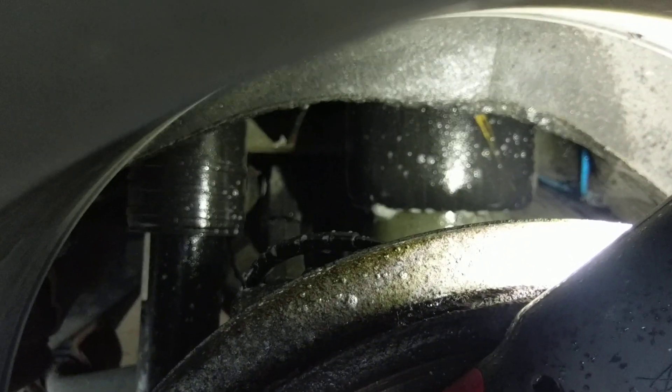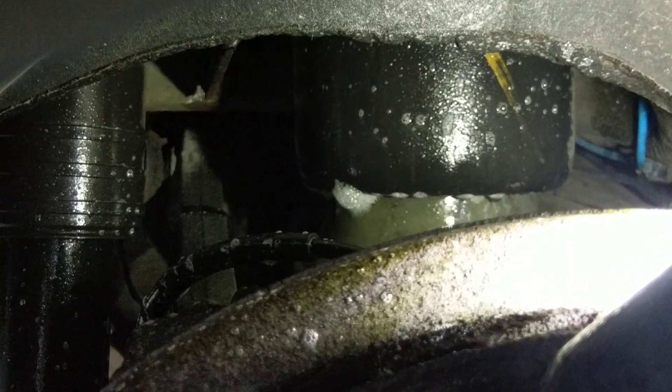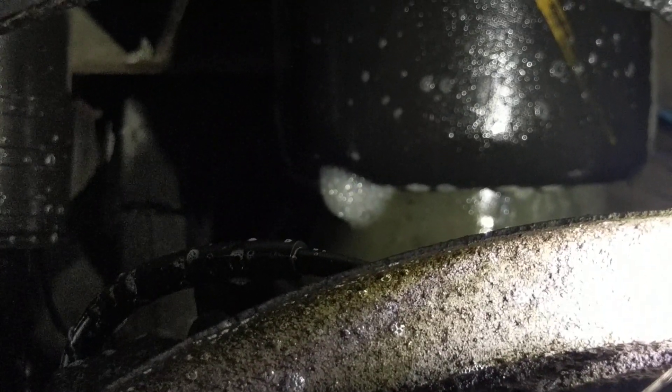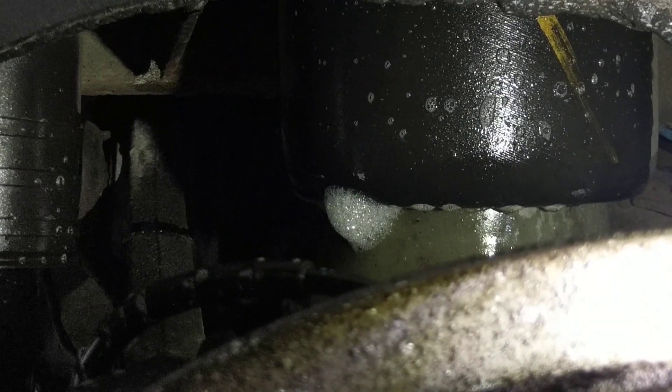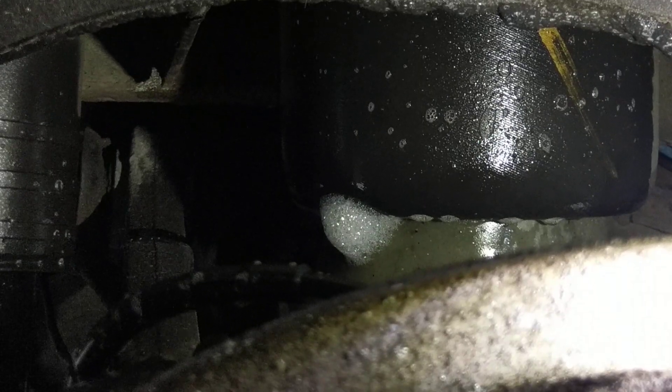Can you see that? You can see the bubbles — zoom in — can you see the bubbles there? It's leaking air. The fairy liquid is blowing out. So this side, the driver's side, is actually leaking air, which is why the suspension is losing air. In the morning when you fire the car up — or even before you fire it up — you open the driver's side door, the compressor kicks in to refill the bags so the car's back at normal ride height. In the morning when I come out it'll basically be touching the ground, nearly ten to twenty centimeters down.